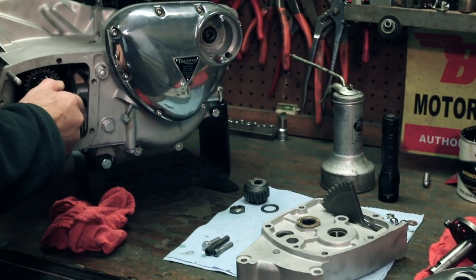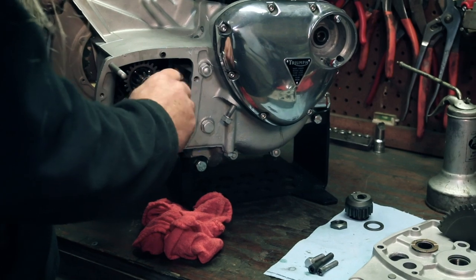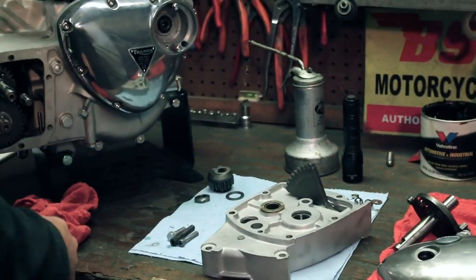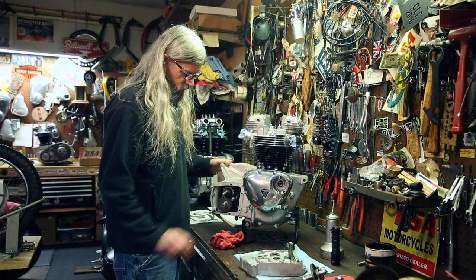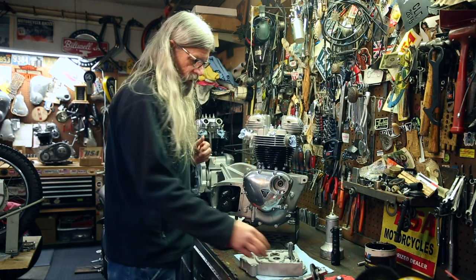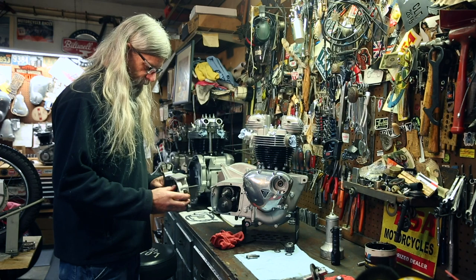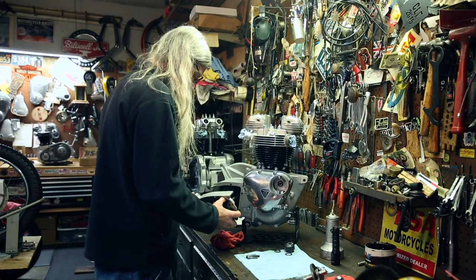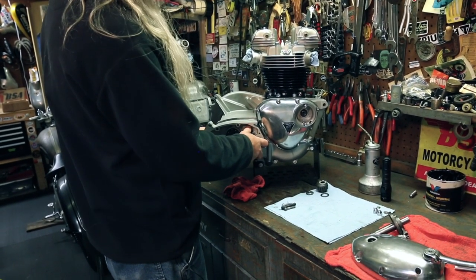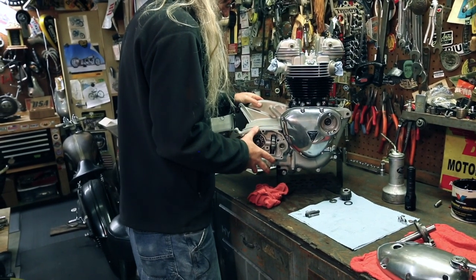And we're in first gear, you can also give her a spin, and make sure it turns freely and isn't trying to walk out, but that's good, okay. Now when we go to push this home, it's gonna shove that way. Don't worry about that. When we put the kicker gear on, we'll pull it back this way. So we'll leave it like that for now. And this is the fun part. We're gonna go ahead and get this started on here. Main shaft's gonna go through that bearing. The end of the counter shaft's gonna go into that bearing, like so.